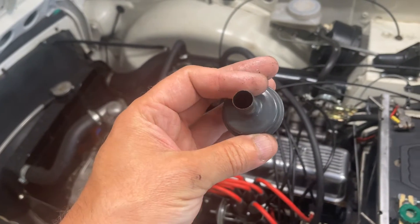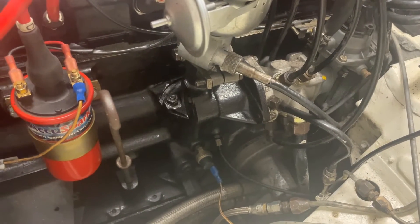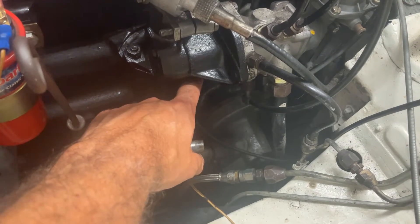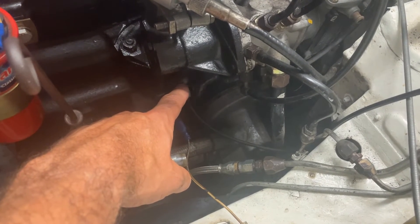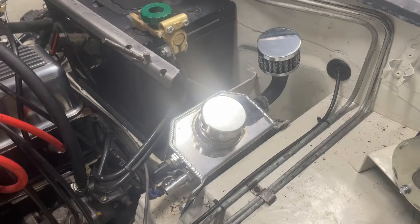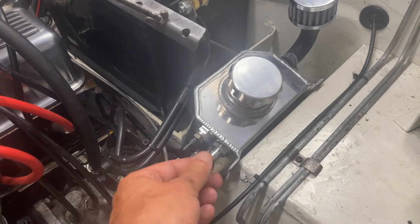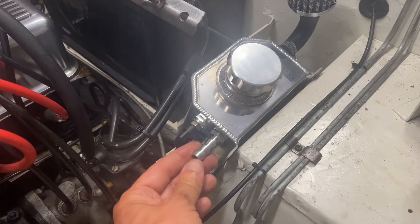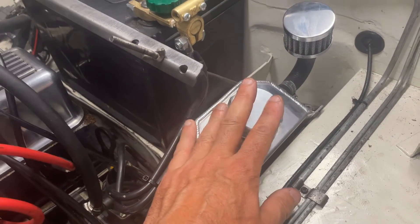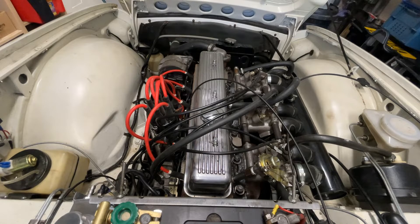Any oil mist in theory should get at least slowed down or caught by that in the bypass pipe. After that I'm going to look at making a crankcase breather. There's an old mechanical fuel pump cover plate that sits underneath the pedestal — I think that's an opportunity to take a breather pipe out of there and feed it up to an oil catch tank, helping to eliminate the pressure building up in the main crankcase. I've been experimenting with an oil catch tank — here's one mounted to the bulkhead — but my experience from the Midget sprint car is that these pipe diameters are certainly not enough to allow an engine to breathe well.